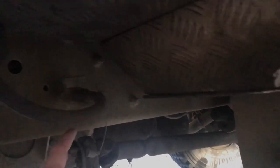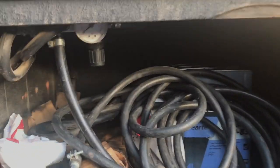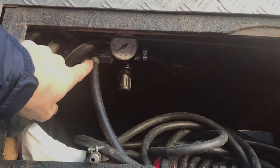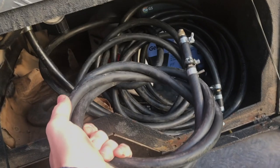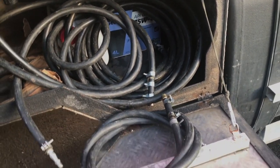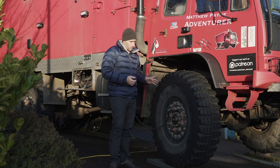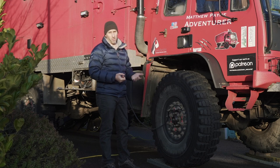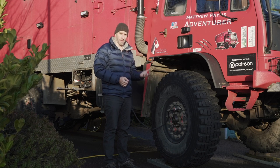This is the connection here which would typically fit your tire inflator. I have this airline running up into a box, which goes to the pressure gauge and then into the manifold where the airlines are distributed to all four corners of the truck. I have an airline for each corner, all the same length, and also a much longer airline for inflating a motorcycle or helping out other travelers. With this setup I inflate all four tires, have a cup of tea, and the job is done. It does cost more than a simple tire inflator, but I went for this system because I knew I'd be airing down and up constantly.